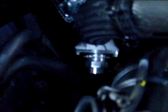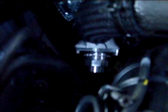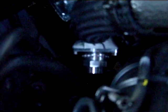Alright guys, as you can see, we have the new Forge blow-off valve in position. Everything was reattached with Forge's new hardware. The bolts on this hardware are in the same exact factory locations. The depth of the screws is actually longer, but as you can see here, go ahead and get a zoom up. The new bolt there actually extends through the back of that piece, but Hyundai was cool and they cut it out just in case, I guess, somebody wanted to use longer bolts.